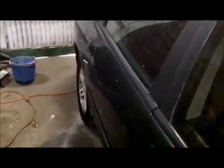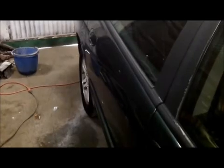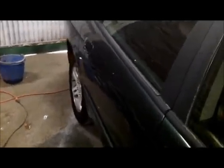But say you did some body work on the door of this car, and it's in primer, and you think it's ready to be painted, and you're wiping the car down for paint, you take your wax and grease remover and you start using that on the panel. Well, while the wax and grease remover is still wet, you can actually look down the side of the panel, and if there are imperfections in it, you're going to see it because there's an actual gloss on that finish. Even before you paint, guys.